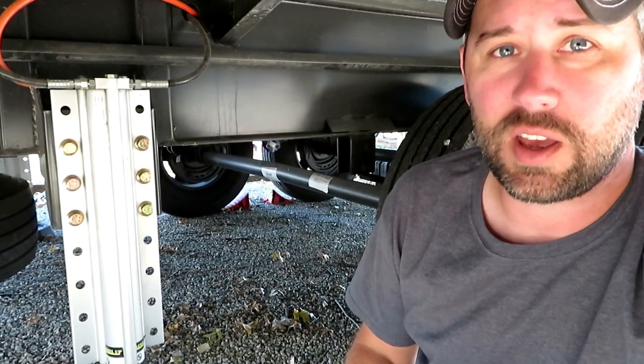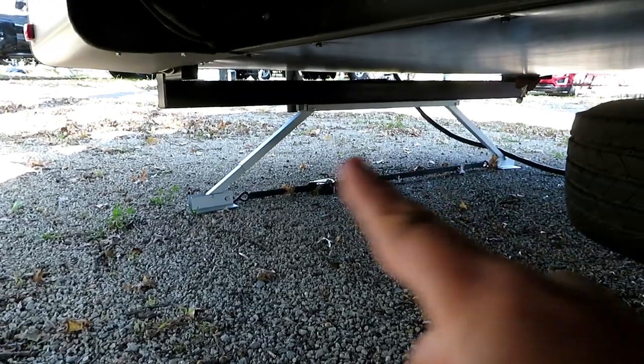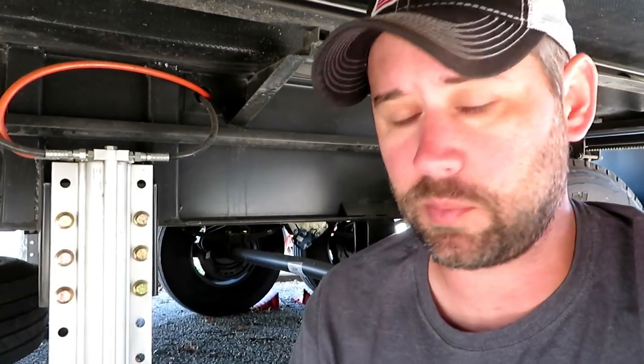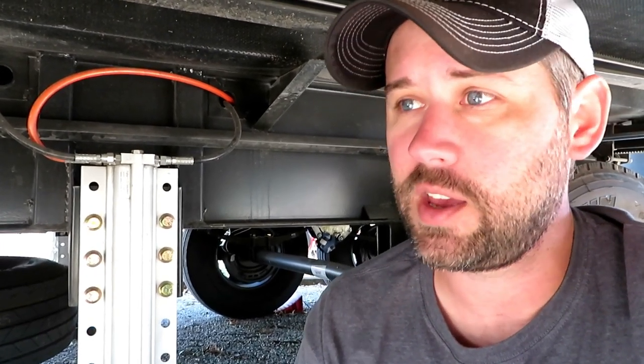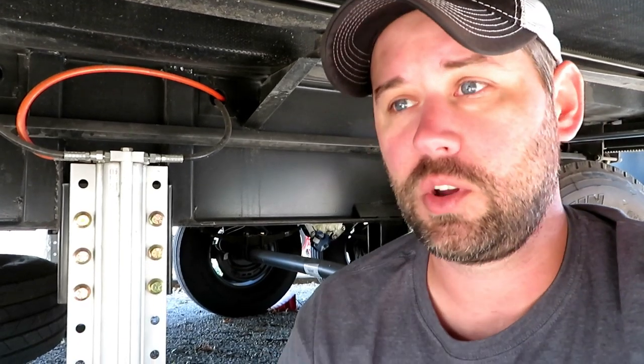The first thing we're going to do is take off the Valterra stabilizers — these guys here — and there's one on the other side underneath the stairs. The Valterra stabilizers don't bear any weight; they just keep the RV from rocking as much. But if you don't take those out when you go to raise the jacks, it'll smash them because they're just aluminum. We had that issue when we were leaving Branson in the middle of the night, evacuated at 3 a.m. — we raised the jacks and smashed one of the Valterra stabilizers. We did a video on those a few months back and I'll put a link in the description.